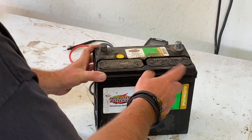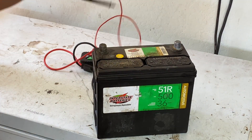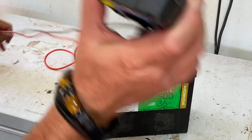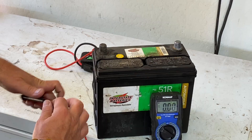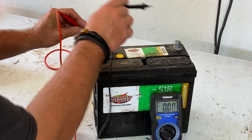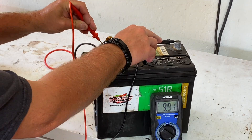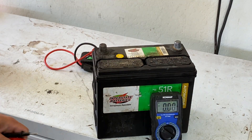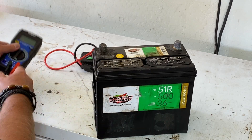Here's our battery. As you can tell, it's got some leakiness everywhere. Let's check our voltmeter and see where we're at currently. Positive, negative — it's showing 9.9 volts. We all know it needs 12.5 or 12.3 in there to get it going. So we'll shut this off.